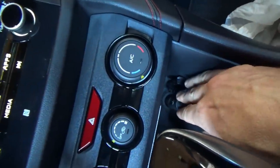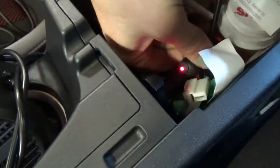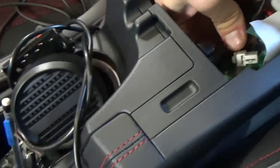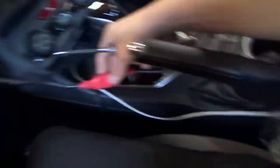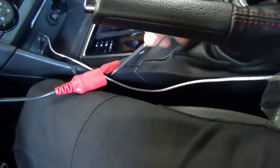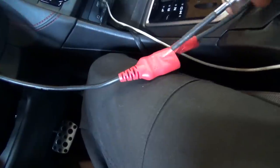The light definitely does not light. A couple of quick checks: use a test light to see if we're missing power or a ground to the outlet. Then look at wiring diagrams, see what fuse it comes from. In accessory mode the rear outlet works fine — the little light lights up. Using a long extension from the battery, we have a good ground and good power at this connector.